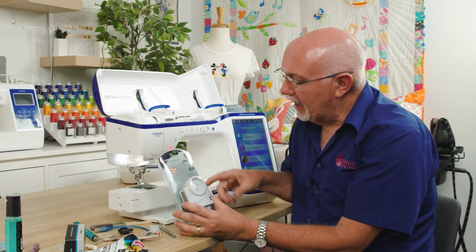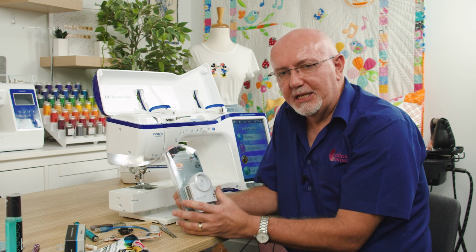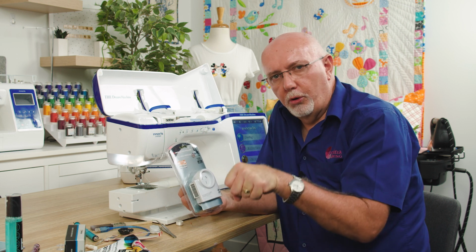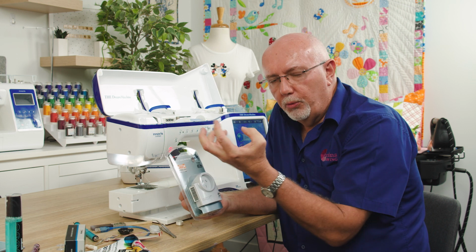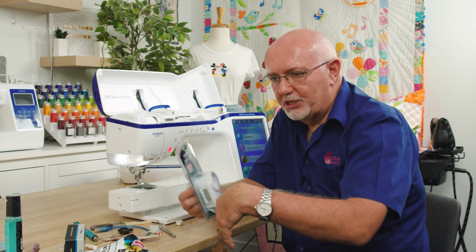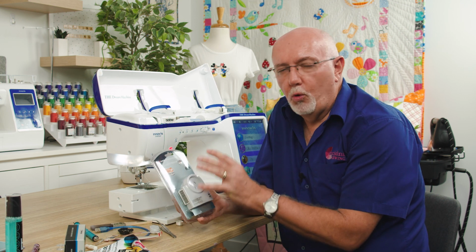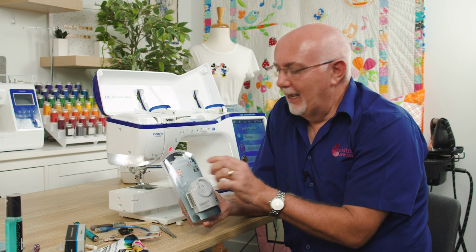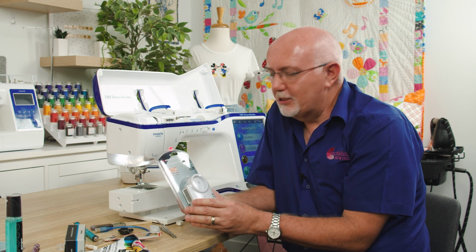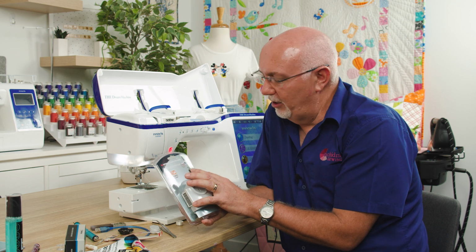And I just want to mention, importantly, how these work. A surge protector is like a sponge. Imagine a big thick sponge and pouring a bucket of water onto it. The sponge will absorb all the water it can until it's completely full, and then it can absorb no more, and the water will just spill out and go everywhere. Surge protection is a bit the same, and instead of absorbing water, they absorb excess energy, and that's rated in what we call joules. So whenever you're looking for a surge protection device, the higher the joules rating, the more efficient or the better that unit's going to be.